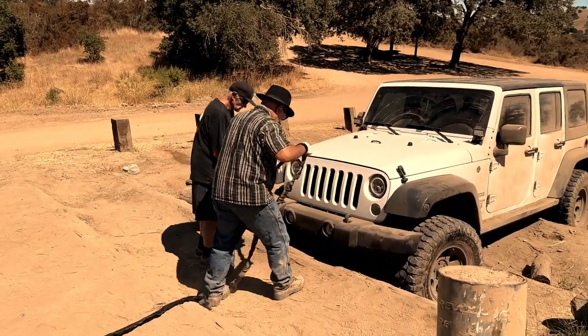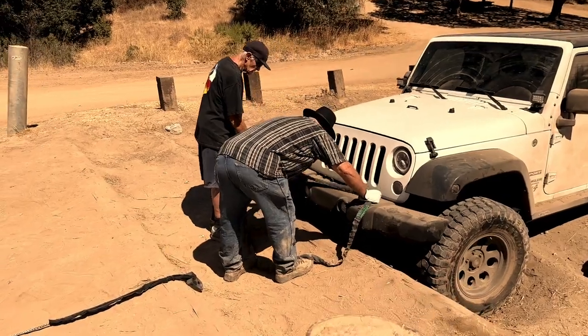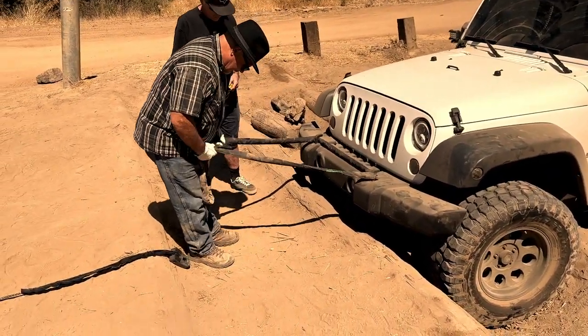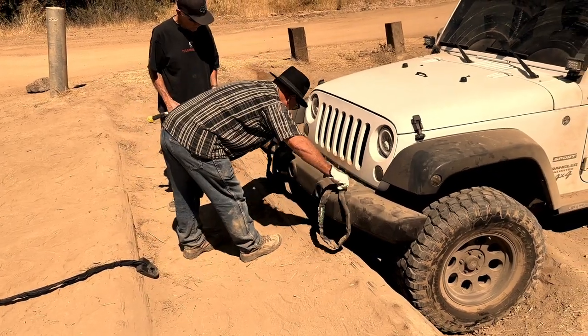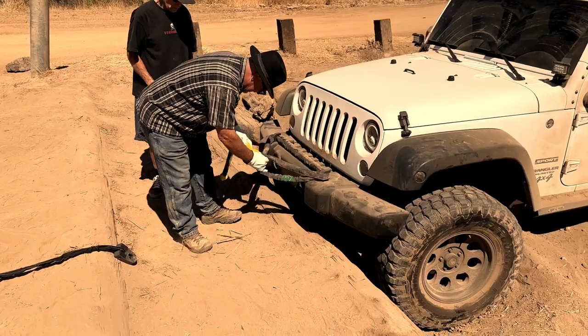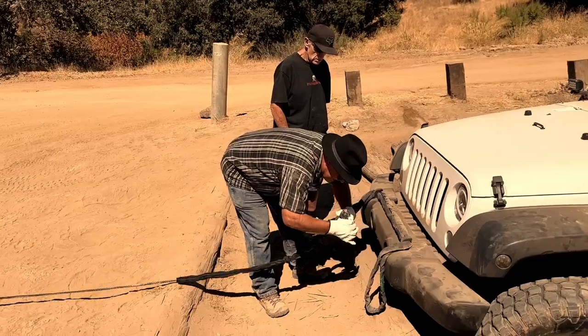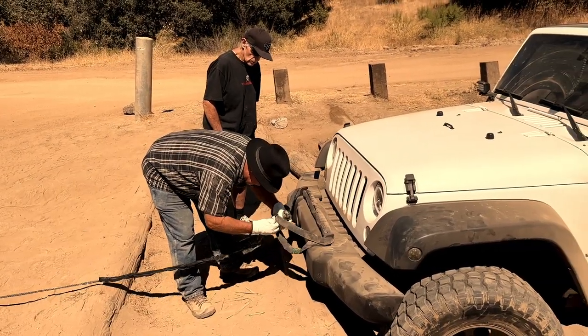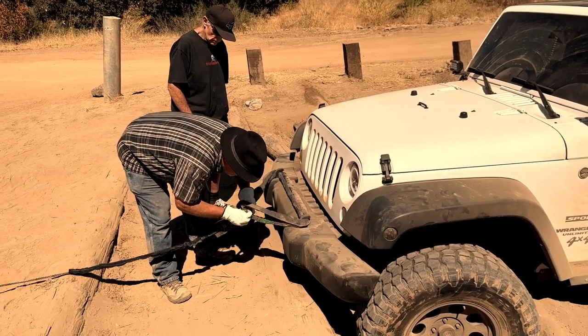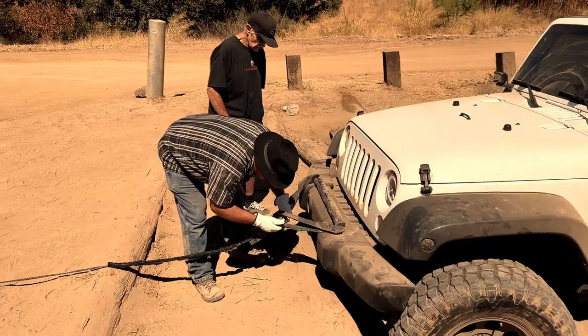All my rigging are soft shackles and soft crane straps. The only metal portion of my rigging is the Factor 55 quick link that's on the end of my winch line. My 40 years of construction gave me a lot of opportunities to work with a lot of rigging and winching systems. Vehicle recovery is much safer with the use of Dyneema winch line and soft shackles.